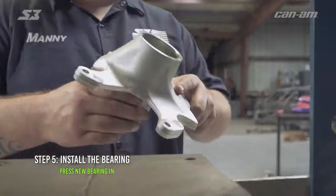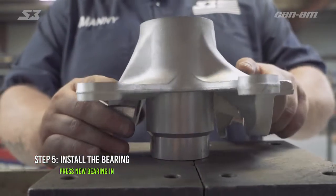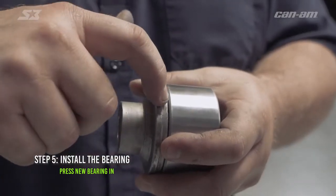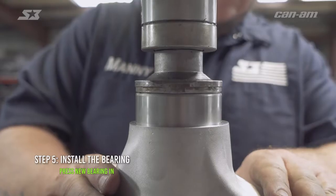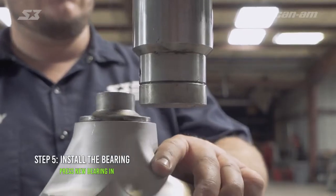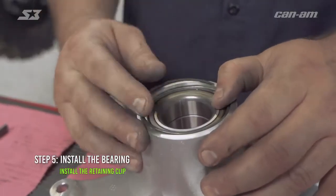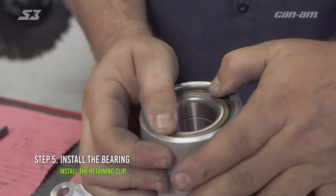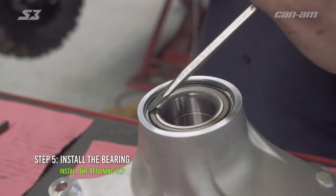We've made tooling to facilitate the process. The trick here is you want to make sure that the knuckle is completely level so that when you're pressing in the bearing, it goes in straight. You need to make sure that it pushes on the outer race but still has enough clearance to clear the knuckle. So you want to make sure that you seat the bearing all the way down and that your groove for the clip is accessible so that way you can get the clip back in. Now we're going to reinstall the clip. Go ahead and press in one side and then start working it around the knuckle until both sides clip in. Then you can take a flathead screwdriver and very lightly and gently just go ahead and tap the outsides of it. Make sure that it's fully seated in the groove.